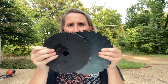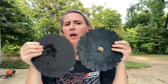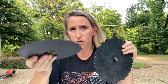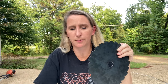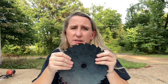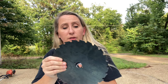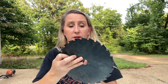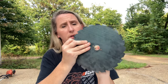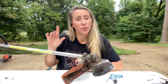If you buy one that is a one inch, they do have reducers available. I'm not going to go over all the different kinds of blades because it really depends on what you're planning to cut - Project Farm does a video showing all the different brush cutter blades and which is best for each project. Blade size also depends on your trimmer's CC power. Most trimmers you'll want to stick with a seven or eight inch blade. If it's a really heavy duty trimmer at 25 CCs or more, you can push a nine inch. They do have reducers to make a one inch blade fit on a 20 millimeter adapter.